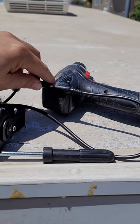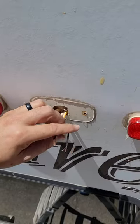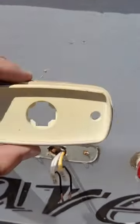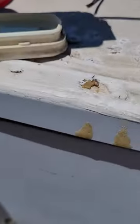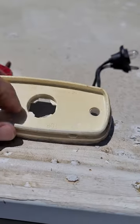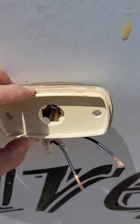You will have to turn your lights on on your truck, and your trailer will have to be connected to get running power back to this wire that's sticking out — then you should have power to your camera. Tuck as much wiring back as you can. Some people will be able to use the existing light fixture, and you should be able to fit your mount inside of there. You might want to pre-drill a couple of holes, then mount it back, tuck everything, silicone it, and call it a day.